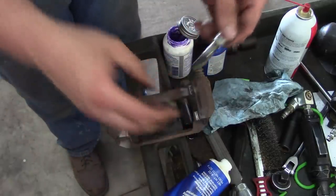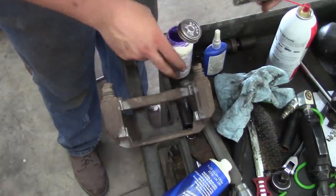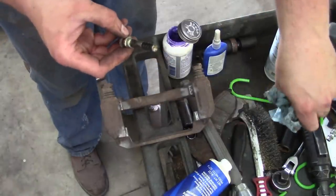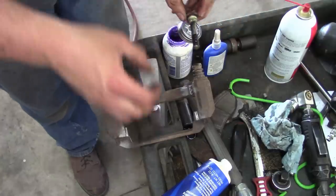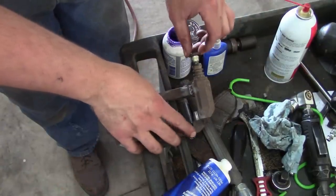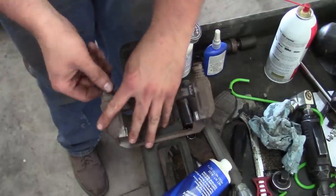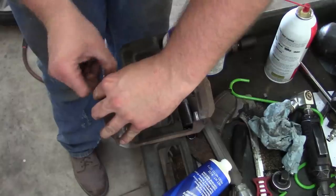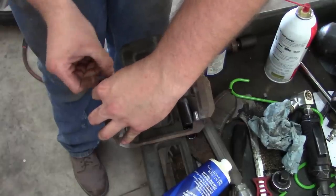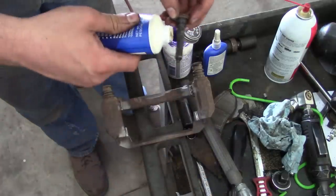Now, there seems to be some controversy with the purple Permatex brake goo. Guys are telling me it's not compatible with rubber, that they're having problems with the boots swelling. I don't know. I tried to call Permatex customer service. Nobody answers the phone. So if I get an answer from them by the time I post this video, I will be sure to include that. So for the time being, we'll use the Sil-Glide. I know it's safe for rubber.